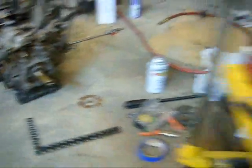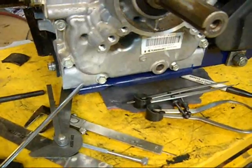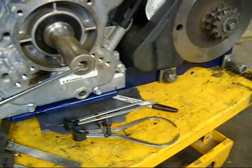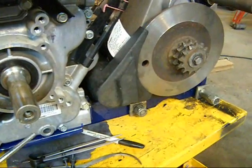That surface there and that surface there are common features. They put the bolts real close to the edge, within a minimal distance, very close to each other. That's what I used to set this up. Originally I was using the end of the crank — the center line of that bolt under there — that would relate my power plate back to my transmission. Problem is, there's an air gap at the end of this, so it's really not relative.